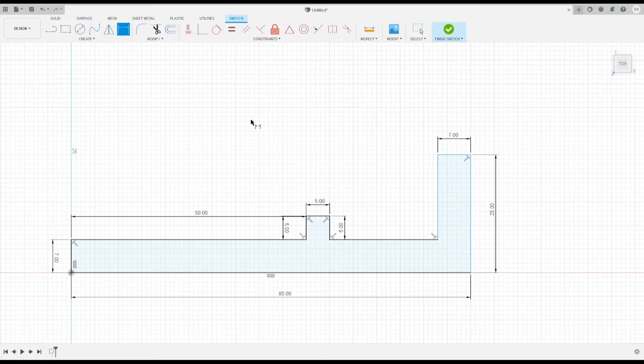Because I don't think these ridges that are in this need to be there. I think they're for structural rigidity. And if I just make it a solid piece, who cares about structural rigidity? I'm going to have plenty of infill anyways. So, basically, this part here where this notch is goes on top of where the freezer door is. And then this will stick down as a handle. That's how it is on the original part.